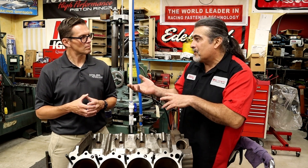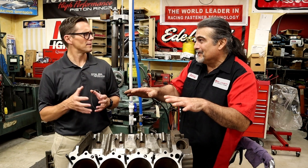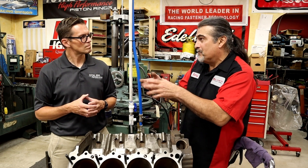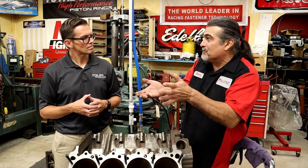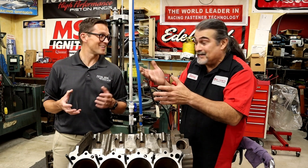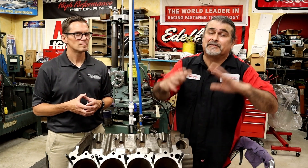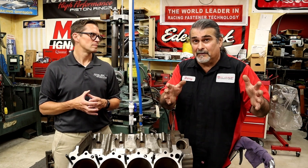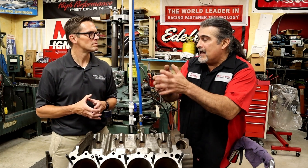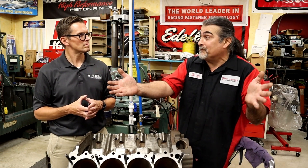Here's an interesting full-circle point: all the late-model cars come extremely balanced and blueprinted from the factory. So if I took an EcoBoost in and balanced and blueprinted it, it'd mostly be a waste of money — you'd mainly just be checking things. But take an earlier model from the '70s, '72, '75, '78, into the '80s — especially the '80s. Chevrolet used a specific bob weight, and if the piston was within four or eight grams of that weight, it was considered okay. All they cared about was avoiding a bad vibration, not a smooth-running engine.